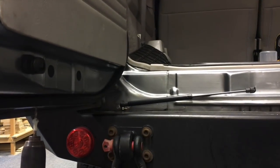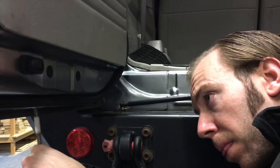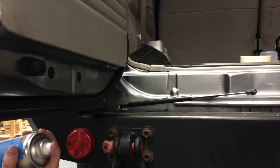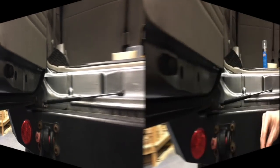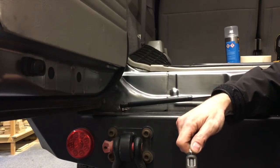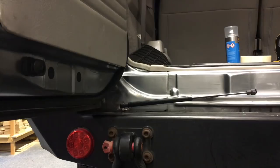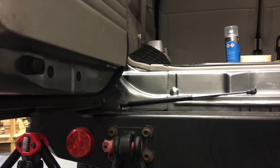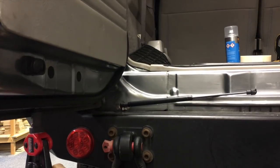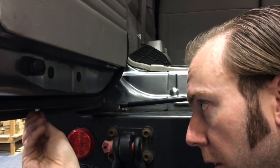Once marked, I used the pilot drill bit and then the 9mm drill bit. Again, don't forget the clear lacquer. In the same way as before, I inserted the rivnut and the tool into the hole. Once it's tight and the rivnut tool is removed, you can screw the other ball joint in and tighten it up with a spanner.